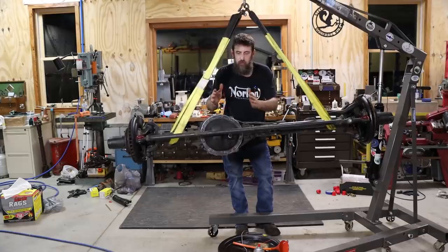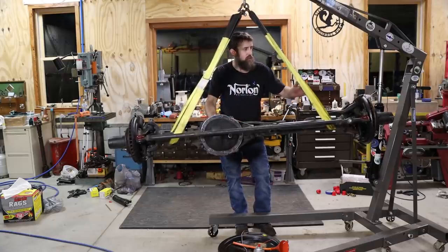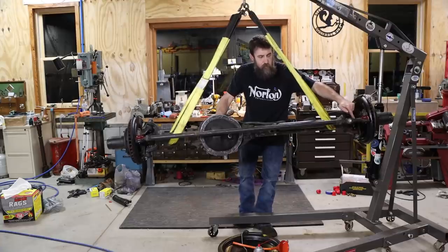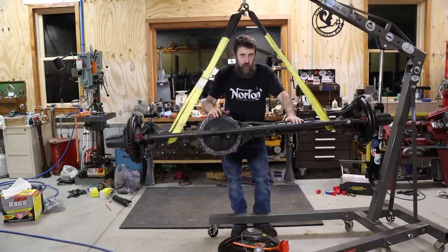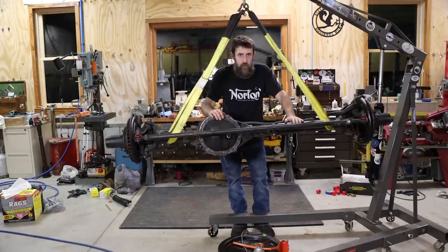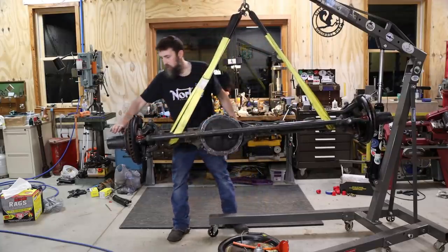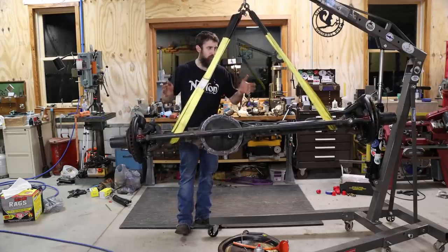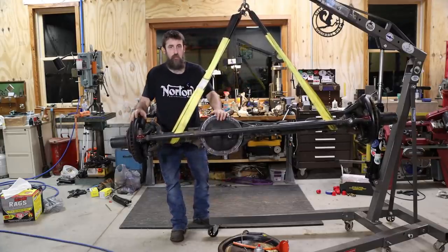So for the lubricants other than the gearbox, which I just mentioned, in our reciprocating parts like ball joints, universals, and tie rod ends, we use the Valvoline Palladium high moly content grease. And in our wheel bearings, we use the Mystik JT6, which I've always liked that stuff. And should be good to go. Hubs are working the way that it should. Nice and smooth. About as serviced as it's going to get.